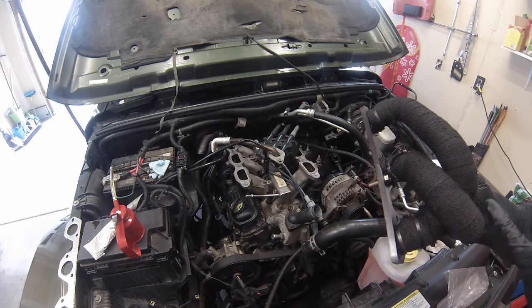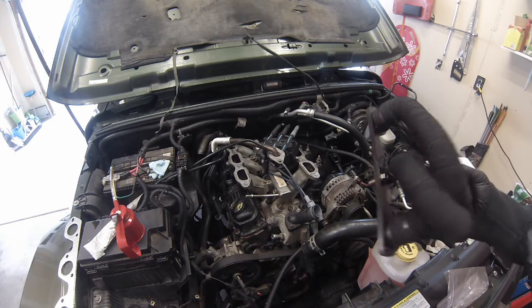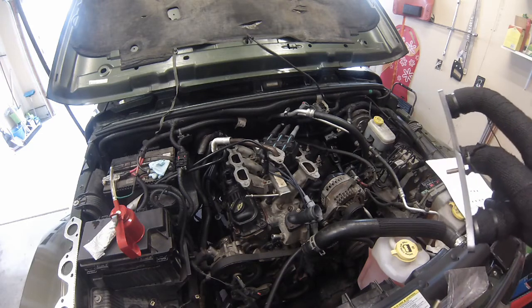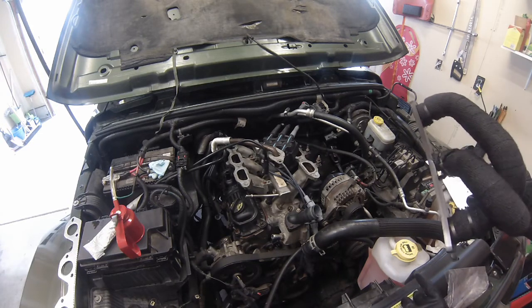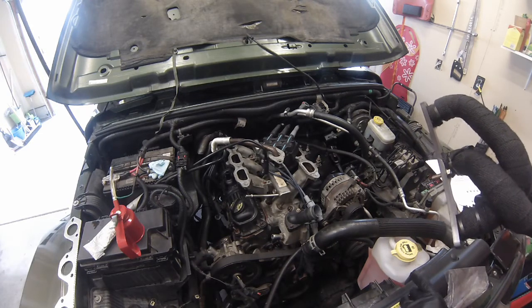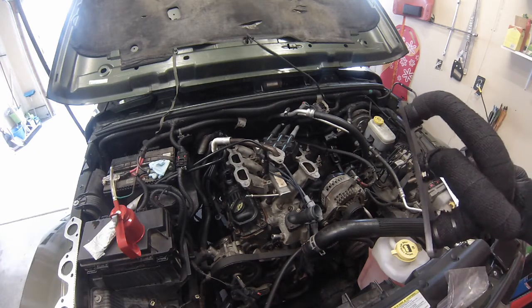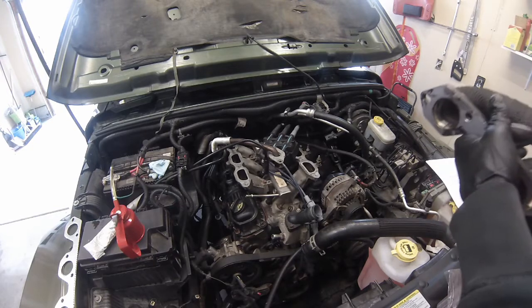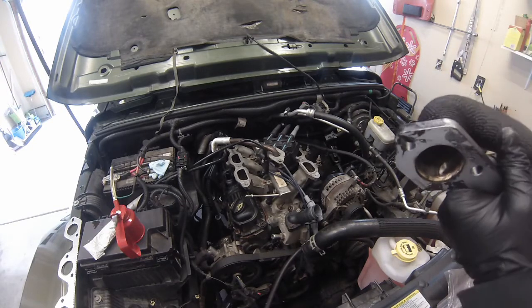I'm using anti-seize. I upgraded the exhaust bolts because if I ever have to take these off in future, I don't want them snapping like the cheap OEM ones do. These will hopefully hold up for heat and expansion a little bit better with the headers. I also wrapped them with fiberglass exhaust wrap and then sprayed them with the high temp silicone spray that's designed for exhaust wrap. I'm hoping between all of that, this exhaust will last the entirety of the vehicle and hopefully not crack.